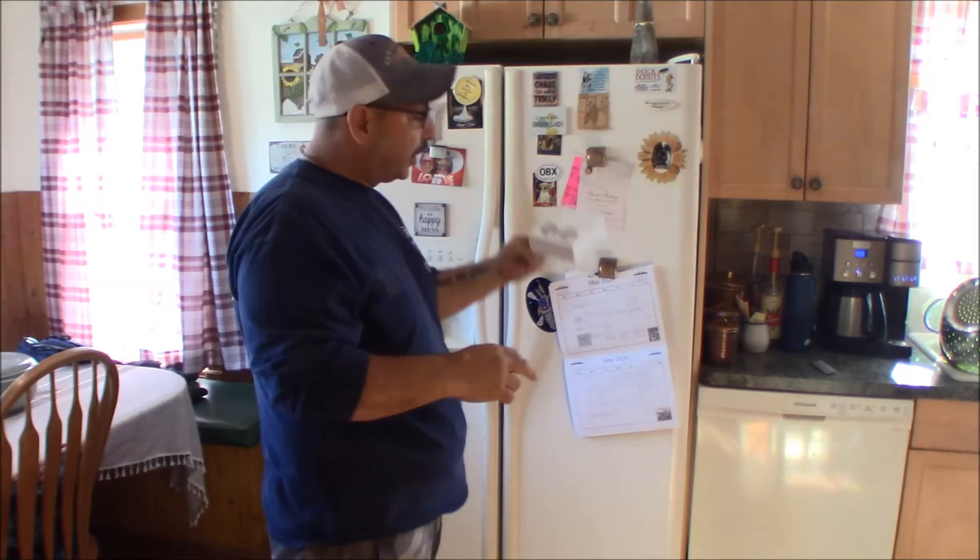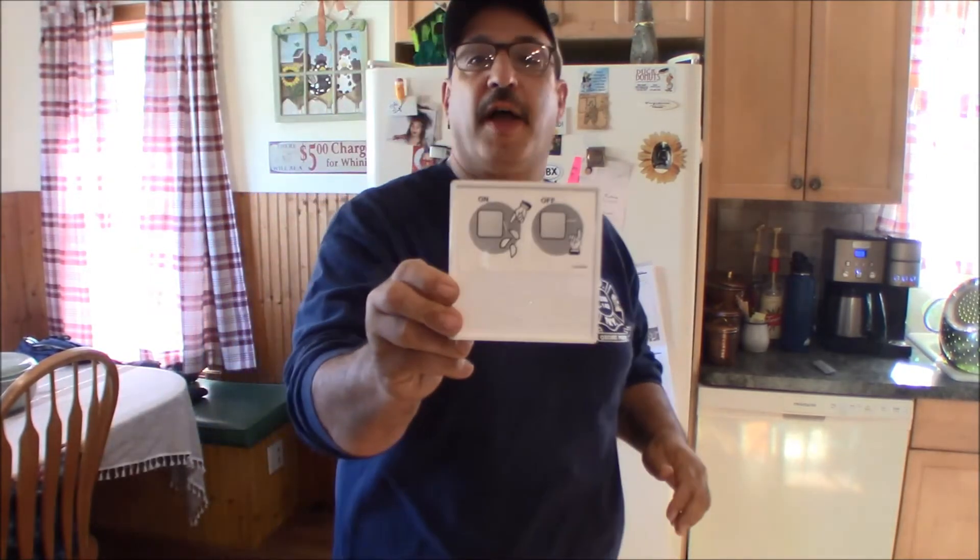We definitely realized the ice machine wasn't making as much ice as it should. I took the cover off the ice maker just to see what's behind it — it was just two gears. I kept opening and shutting the door until I could see those gears actually turning. They work like a timer: the ice gets frozen and then the gears turn and it dumps the ice. I kind of forced them to start turning again and very slowly they were turning almost like a clock.